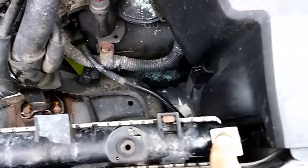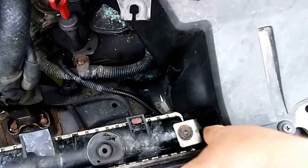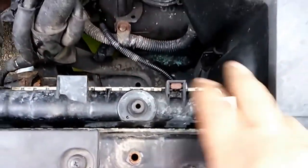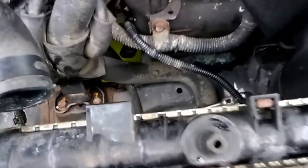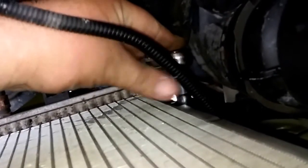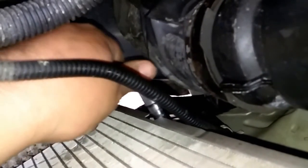There are two bolts here on top and another bolt just a couple of inches down here on the side that I'll have to get to with a wrench — that separates the AC condenser from the radiator. That bolt a couple inches down is not one you take out — that goes to the bracket for the AC condenser, not the radiator. On both sides, partway down, there are a couple of bolts right here where my socket wrench is right now. I already took one out, but there is also one on that side as well — not hard to get to.